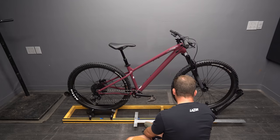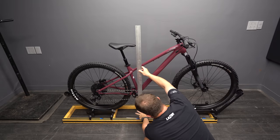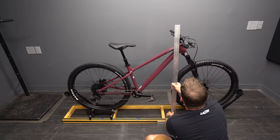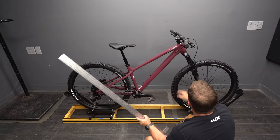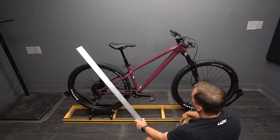Reach is 440 on the money, right on with the geo chart. We have a 63 mil bottom bracket drop. Stack is 643. Nice tall stack for a 130 mil. I'm glad this isn't any shorter. Bravo Cannondale for doing that.